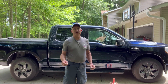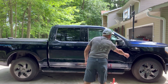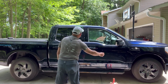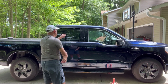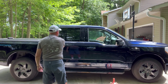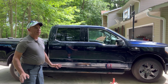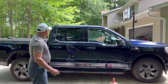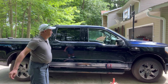So we're starting on the passenger side first. The way the tire rotation goes is the right front tire goes on the left rear. The right rear comes up to the right front. Then ultimately the left rear that we take off to put this one on there goes up to the left front. And the left front comes back here to the right rear. I may not have said left and right, but I think you get the idea. Otherwise, look at the manual, there's a diagram. Basically, the 2 back ones come up and the 2 front ones crisscross going back.